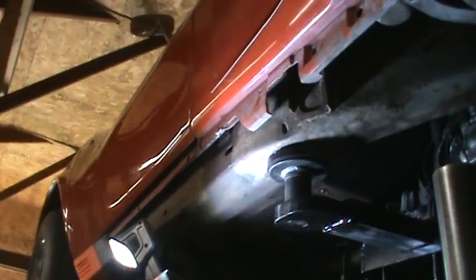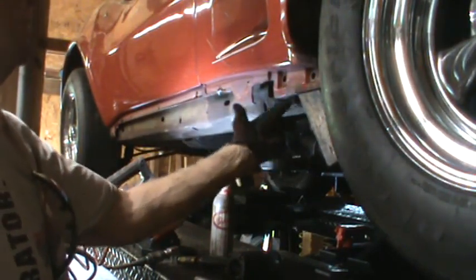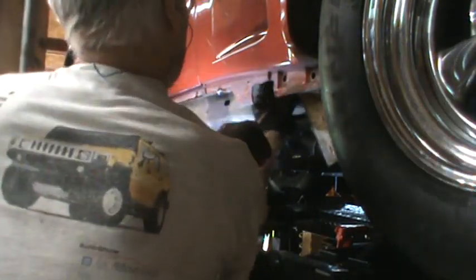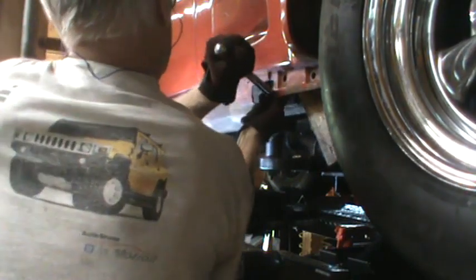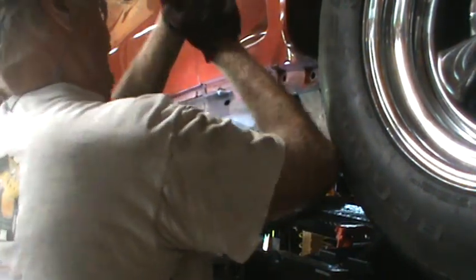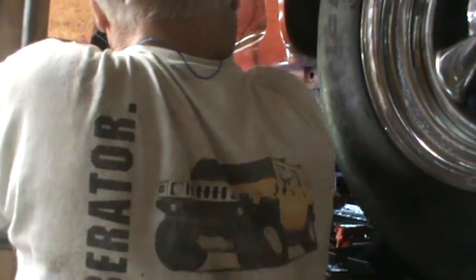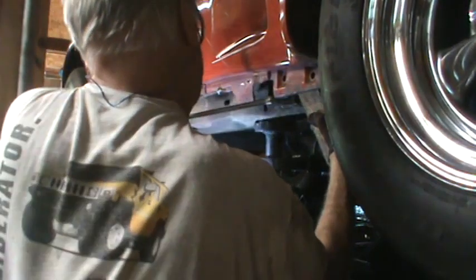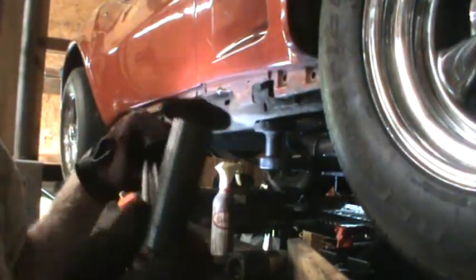That's not working very well, so I've got a piece of 2x4 stuck up here and that's bracing against the ratchet. It appears to have gotten some movement - I'll put the breaker bar on. Sometimes that's what you've got to do to get it off.